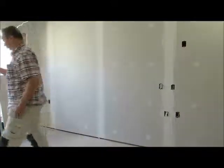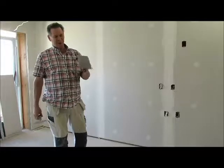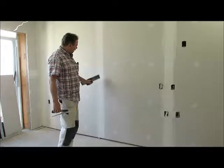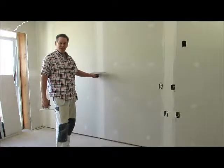Now we're ready for a double coat. I normally use a 14-inch curved trowel — it has a slight curve to it. The theory is as you're troweling on, when you get finished it leaves a little bit higher in the center, because normal filler out of the box when it dries will shrink a little bit.